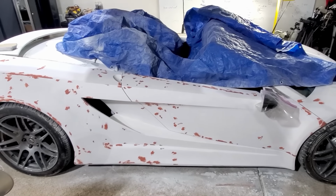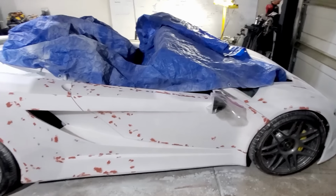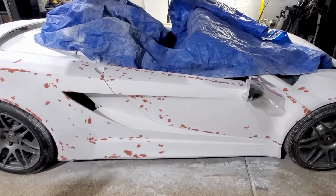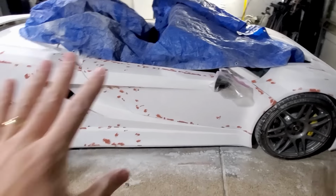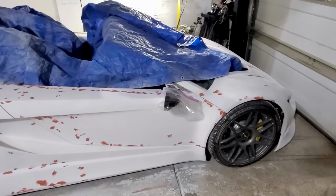As I go back over and sand it, it'll help me make sure that it's all taken care of. So first, I think I'll do like 320, do everything. Thinking maybe even wet sand at 320, just because I feel like it helps things not get clogged. And then maybe I'll go to like 400 or something. And at that point, I'll say this side, the front, the other side will be ready to go.